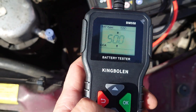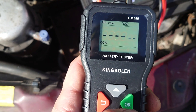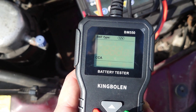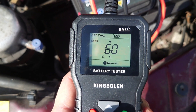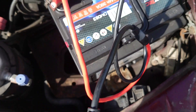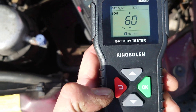Let's give the Diplomat a check. This one's a 440 CCA — it's a little budget battery that I bought. The result: 339 CCA. State of health 60%, state of charge 90%. Interesting — that's not that old a battery, but it is a cheaper one, so we will keep an eye on that off the back of our little gadget here.